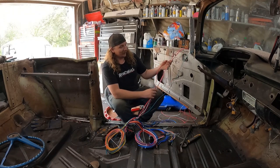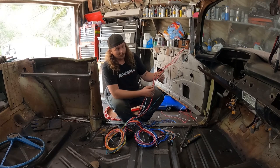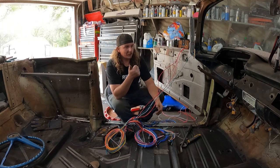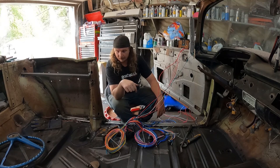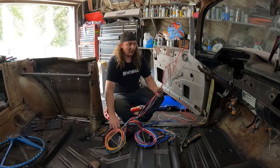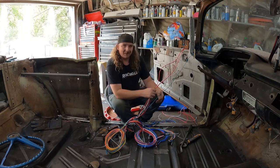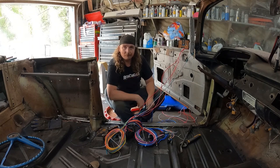What I'm starting to do here — one wire goes to the battery, so that's power to the box itself. One's the charge wire, exciter wire for the alternator, the positive side of the coil. Those are all kind of the same. This one here is for the horn. And then there are some other ones which will be senders — temperature sender, oil pressure sender, stuff like that. I'll probably run mechanical gauges, so I won't use those. I'll bundle all the front electrical on one bundle, and headlights, turn signals on another. Senders and whatever will just bundle up and leave under the dash.